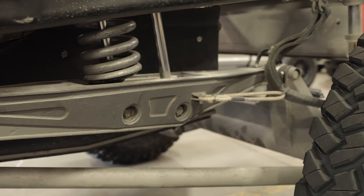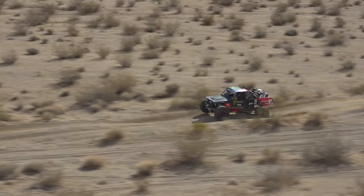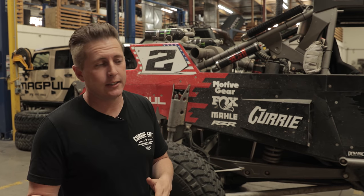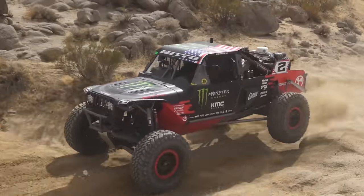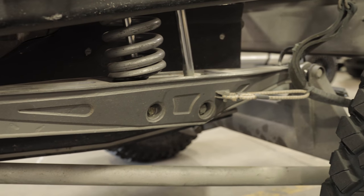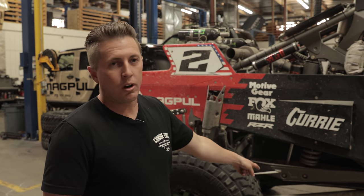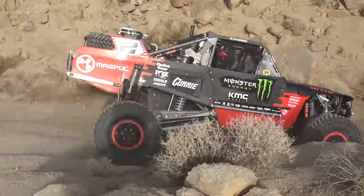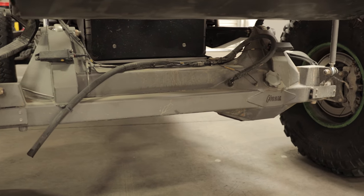Right now we're strapped at 27 inches of travel, bumps at 29 — it's got a ton of travel. When I originally built it I wanted to be able to race both rocks and Baja. I did win Crandon in the rocks so it does work, but the Hammers has just been killing me. I run a reverse four-link so the trailing arm is up top — by doing that I raise the trailing arms getting all the big stuff out of the way, which in the rocks opens it up for less stuff to get stuck on. Aluminum lower arms, high arms on both ends from FK, tucked in for a reverse four-link — super tight and narrow, making the bottom of the car really open and easy to drive in the rocks.